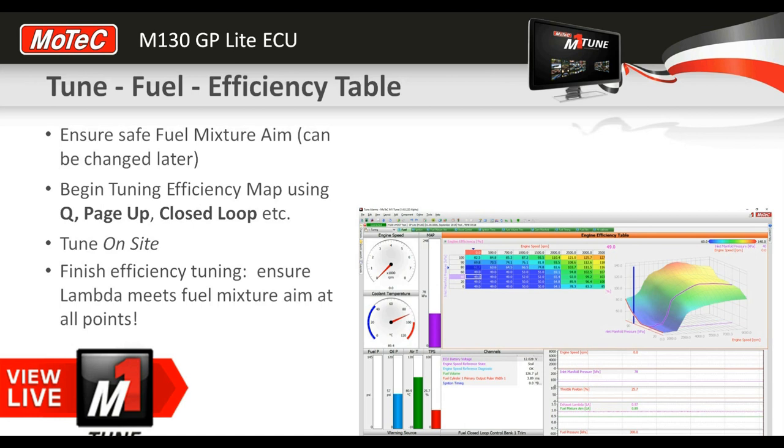Right, so again, you should have everything tested and checked. So the process is we basically start the engine and warm it up and then start tuning the efficiency map. And you do that using the Q key, quick lambda, or page up and page down on the keys to make the number larger and smaller. And as soon as the engine's warmed up, you can also use closed loop fuel to do that as well.